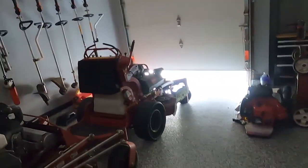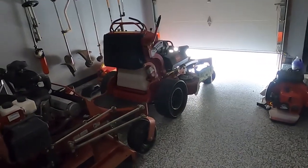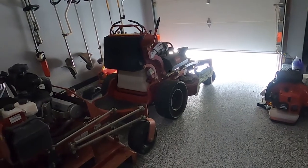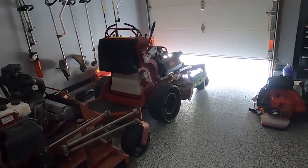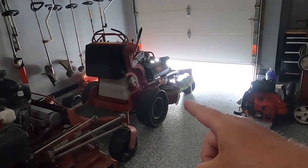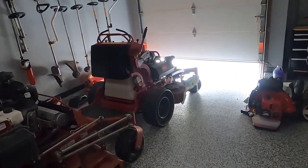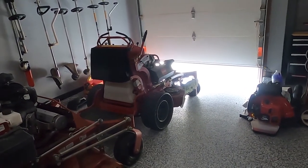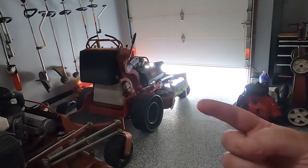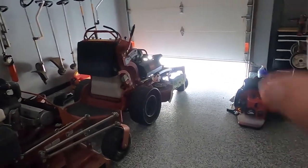What's going on guys. Today's agenda: I've got to go to the dealer and get a new idler because the one that's on it always wants to throw the belt. No matter if the deck's up, down, half throttle, full throttle — it doesn't matter. It wants to throw the belt and then it sucks it under the pulley.